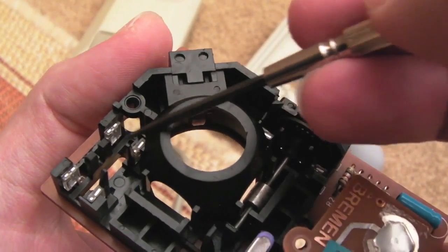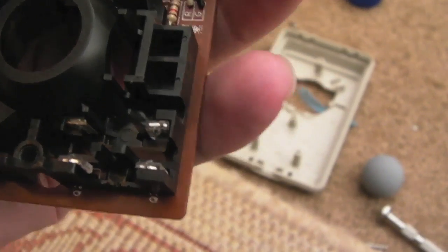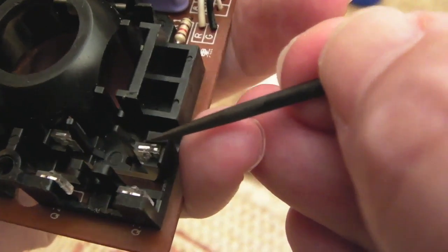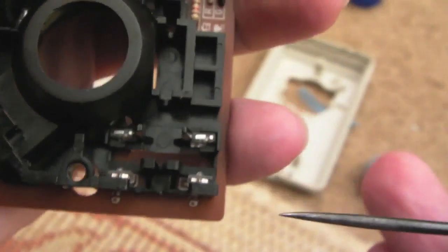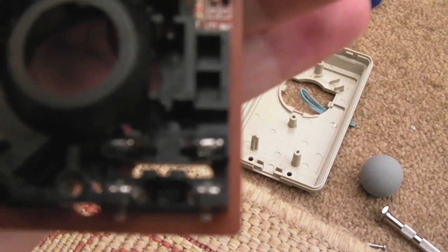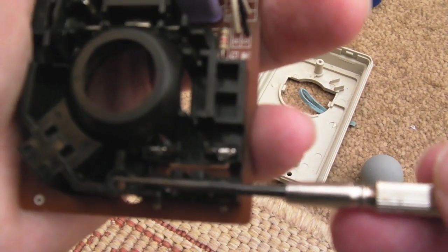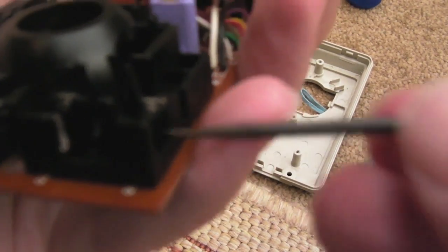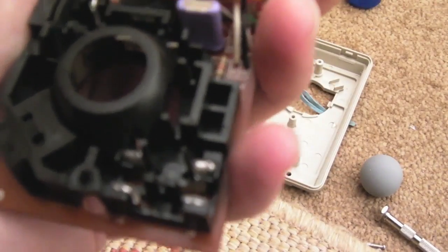Something else I think I'm going to do here - can you see the diode side, the output diode, the emitter? It's coming up towards this point here and down towards here - it's like a slant. If that's straight, it's like that, just ever so slightly. If you look at this one here, those are dead in line, totally in line, and this one here is in line with those two - but this one's out by, I don't know, one or two degrees. So it's not going to be pointing straight at the receiver. I'm going to twist it very carefully with a pair of fine-nose pliers.